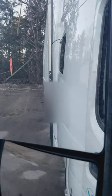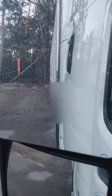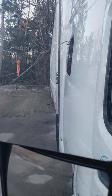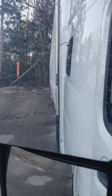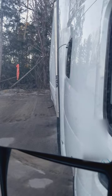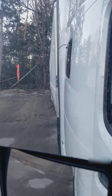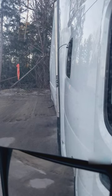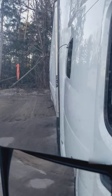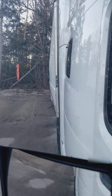This is pretty much the view you will receive when you're backing up. And like I said in a previous video, if you're not used to seeing this, it's very easy for you to overshoot the fifth wheel. It's very easy to high hook. A lot of people are mistaking high hooking for overshooting the fifth wheel. However, you can get a high hook if the trailer is too high and the tractor is too low, and you can also overshoot the fifth wheel as well.